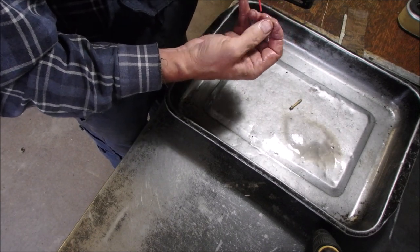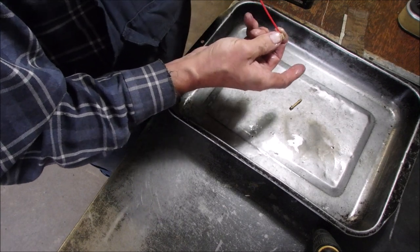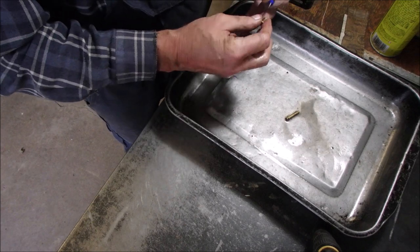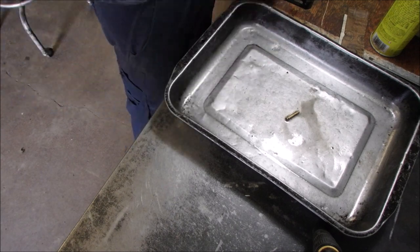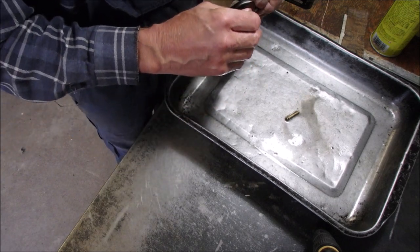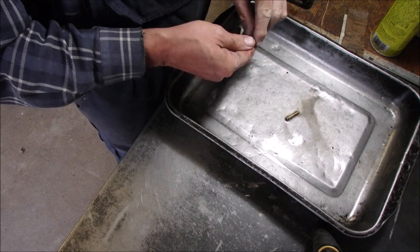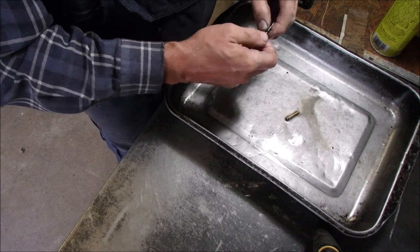Shouldn't have to increase the jet size on this one. But it is a little raspy. Let's just get the kit. Still a pretty small hole. I'm going to go up one more. Yeah, that's perfect. Slightly bigger engine, eh? The last one I did was 140cc, and I used the one downsized from this one. So that sounds about right.